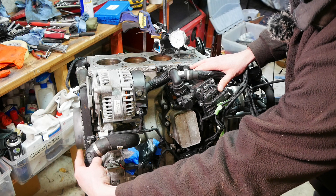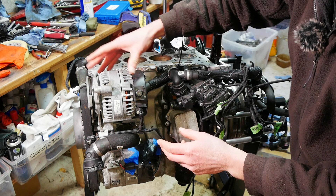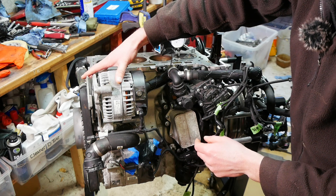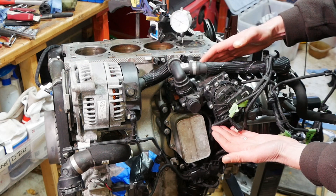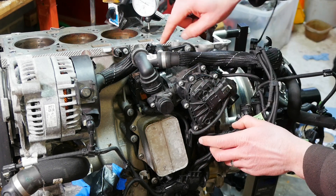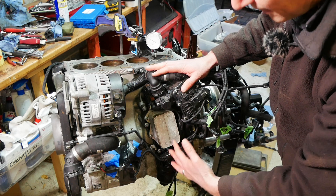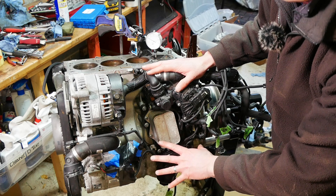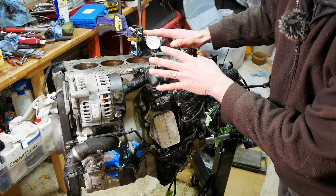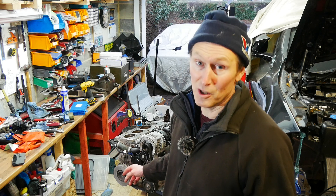While we're in this area around the water pump, there'll often be a thermostat nearby — on older engines it'll be mounted near the water pump with hoses going into it. But on a lot of modern engines you'll have what's called a heat management module, and as you can see there's lots of coolant pipes that come into it, plus lots of actuators and electronics. Every one of these connections and connectors is a possible source for a leak. So on this particular engine if you saw a leak coming down the side landing on that cardboard underneath, this might be a good area to check — you may need to get the engine cover off to see it. By the way, I've got this engine out because I also do car project series and this is a water flood damaged car where I'm seeing if I can repair it.